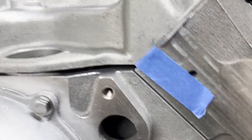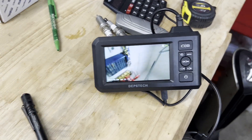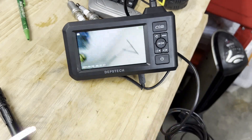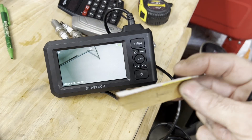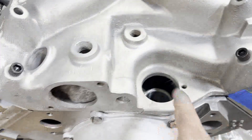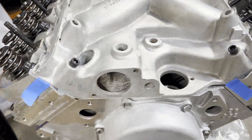If you're looking for different methods of checking for pushrod clearance, a scope is really good. Thick cardboard is good — if you can slide it shaped down over the pushrod into the tube and it goes, you're in really good shape. You can also turn out all the lights in the shop, put a big flashlight down in here, and you can see light appearing around your pushrod. Everything was really good — you just gotta be creative.